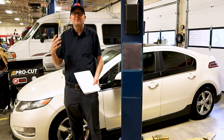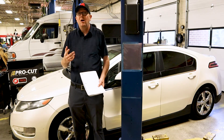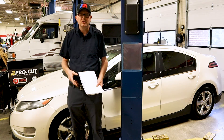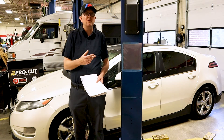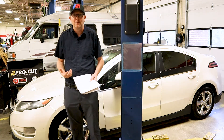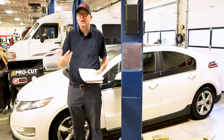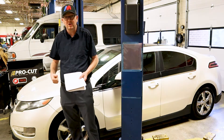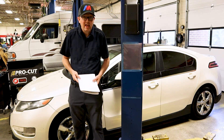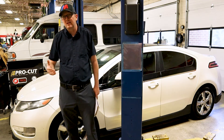There are some aftermarket companies that make AGM batteries that are compatible with this car. However, I think if you can go with the factory-recommended anything, you should. So we put a 12-volt battery in this car and I started getting something. The car came on, but it would not go into drive mode and it would not charge. I tried to plug the charger in and the EV battery would not take any charge, and I must have had 75 codes in the system.